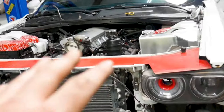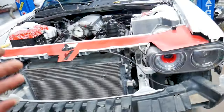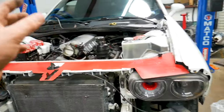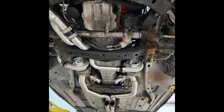I didn't really film, but I've been doing a lot of prep. I've got the front bumper off and the headers are all off. So now we can start moving forward with doing the intercooler, doing the piping, and just overall getting after the turbo kit. Unfortunately I don't have a lot of video footage from the twin turbo kit install, so I'm gonna throw some pictures in here while I talk about it a little bit.